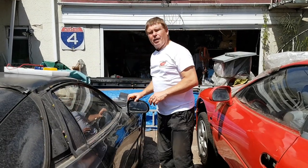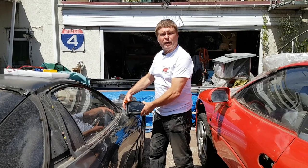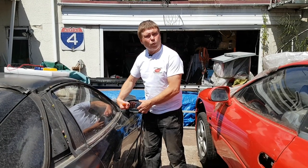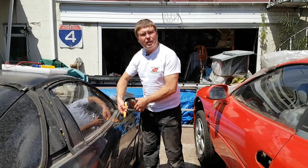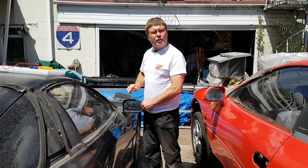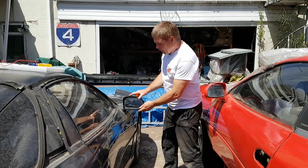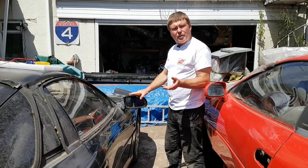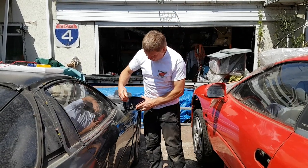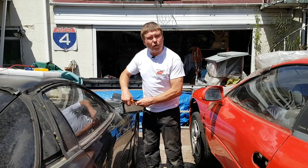In order to remove the mirror, I personally like to take the mirrors out with the entire unit on a bench. The reason is I've had a couple of them where no one connected the wires behind, and as I've picked out the mirror it's dropped onto the floor and broken. However there is no reason at all why you cannot remove this glass in situ, and that's what I'm going to do with this one. The process is relatively simple, and it's only simple if you understand how to do it. I've seen many people try to go in through the top by getting something under there and levering it out, and all that's done is broken the glass.